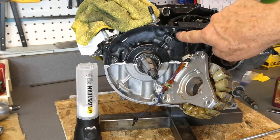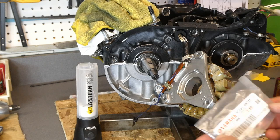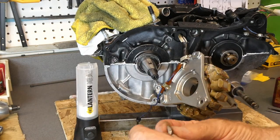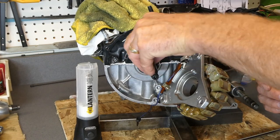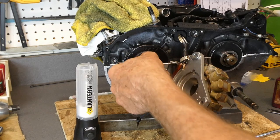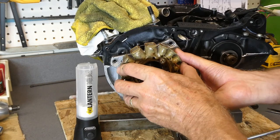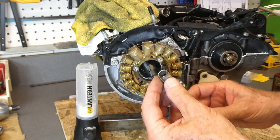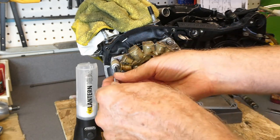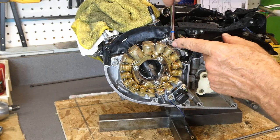Stator installation. I was able to shove this grommet through, kind of pulling on this side without any tools. Here's a brand new Woodruff key - it's interesting that they put a little tick mark in here, I think to keep it secured in there. I cleaned this shaft off with acetone per the Yamaha manual. Blue Loctite on the screws. This might be the very reason I ground down a 10 millimeter socket some time ago - because it's really hard to get in here with a full socket, but with this ground down one I can get right in there. Tighten these to 7.2 foot-pounds.